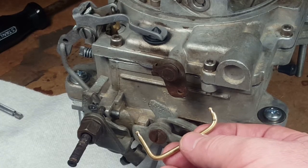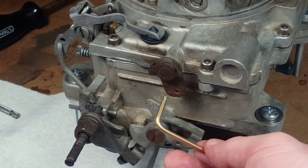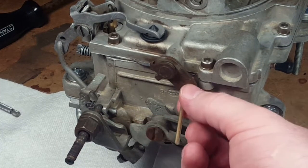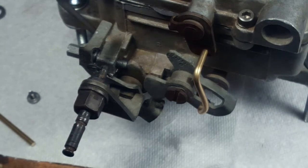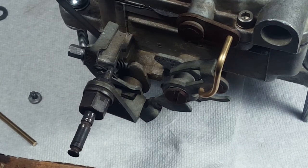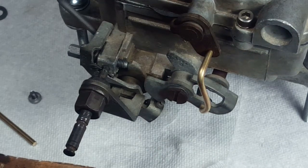And I was going to use double snap rings, but I don't really have room for the double, so I cut them off. And so that's going to fit in this one, and this one fits in that one. So it works. So you pull the throttle back, you close the choke, and it puts it onto the little idle cam. So then when you take the choke back, then it will drop out. So I think that's the last thing. From here, it goes back on the car.